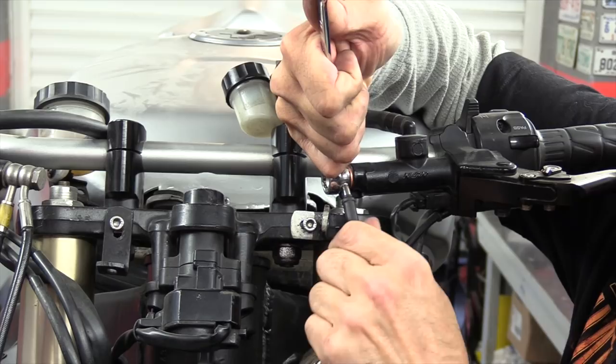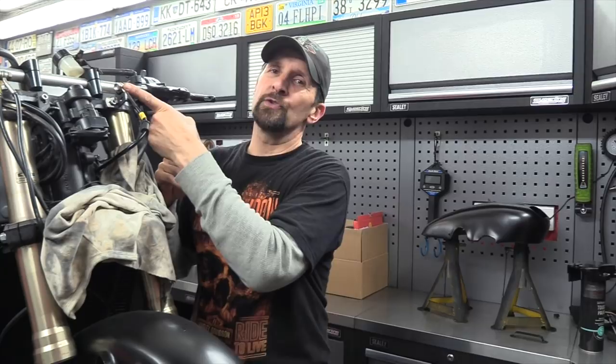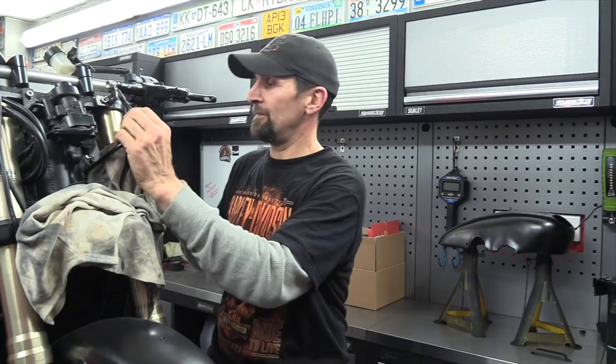Okay, that's it installed and bolted up tight. Now, if you're gonna do this yourself, always make sure that you torque these up to the correct torque in your service manual. Over many, many years, I've got the right feel for it. Because you've got copper washers that are soft, so it will do up and then there's an element of squish and then it goes tight. Just experience, but if you're not sure and you've never done that and you're not confident in yourself, use the right torque setting. Simple. Right, there we are.